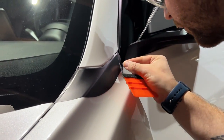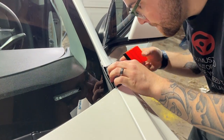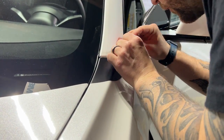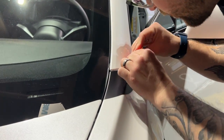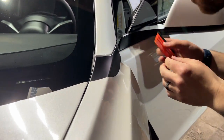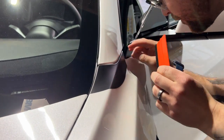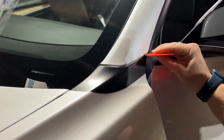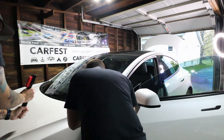Open up the door for this part and tuck in those corners into the edge of the panel. Take your time with this — it's really easy to tuck these in. The foam end on the orange squeegee makes it so much easier. Make sure all parts of that vinyl piece are tucked in nicely to the panel. Go over it a few times to make sure everything is nice and tight so it doesn't come up. There is our first piece — it's looking pretty nice!